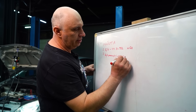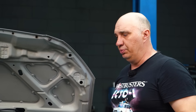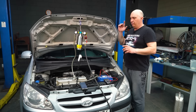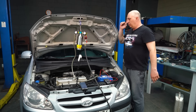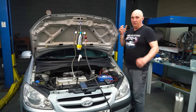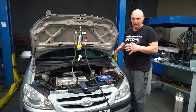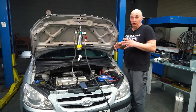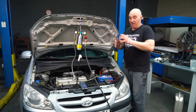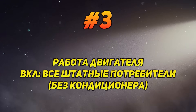Now we're going to fill the canister with half a liter again, but this time we go all out with the accessories. Switch on the headlights, fog lights, high beams, rear window defroster, heated mirrors — everything we've got — to put as much load onto the alternator as we possibly can. That in turn will put load onto the engine. Fill up, switch everything on, start the engine and see what happens. Engine running with everything on, minus AC.